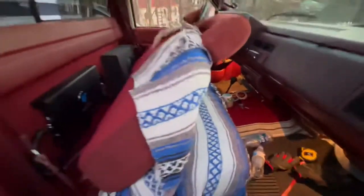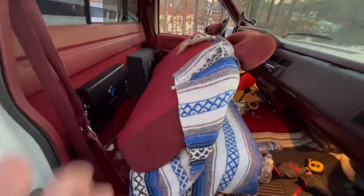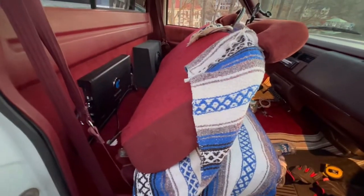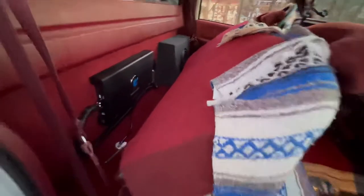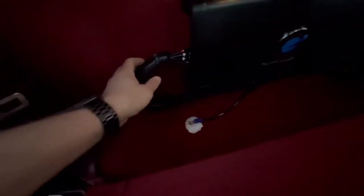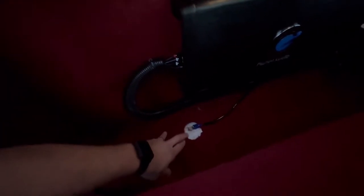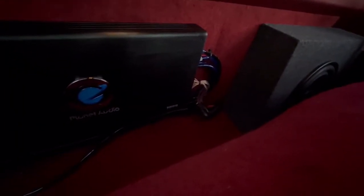The wires and everything I went down and underneath the carpet. For a standard cab, it was easier just to pull the bench out. That gave me an opportunity to actually clean the carpet and the seats really good, and made it easier to install the wire. I came in with my RCAs on this side, just because it worked to have the ground screw right there, but also it definitely keeps your speaker wire away from the power coming that way. Then just hooked it up here.